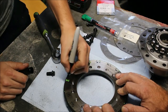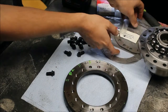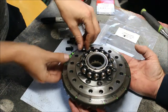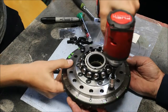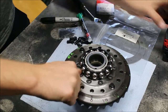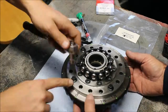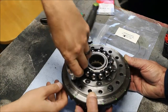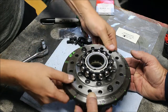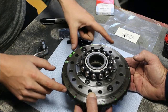Now that you know how many turns you can get out of these holes, we're going to put the baseline shim back in and bolt it up. Make sure it stays well aligned. With these tight, you shouldn't feel any play, but just check a couple of these bolts. We're going to do the same exercise — see how many turns it takes to unscrew it. Seven, and just about seven and a quarter. We know it takes seven and a quarter turns to get this tight. Since all of ours were seven and three quarters or eight, we know that with the current shim installed, we can't bottom out the holes.